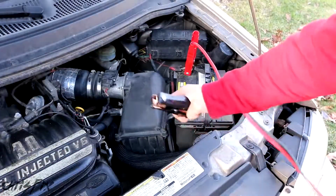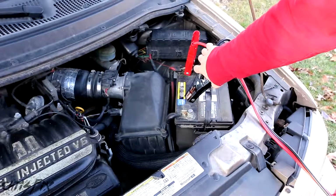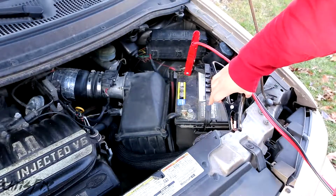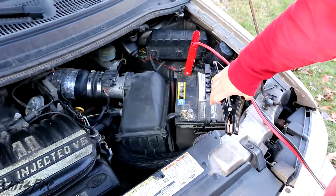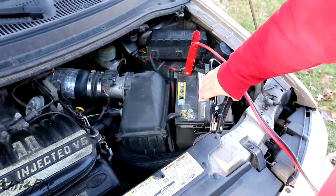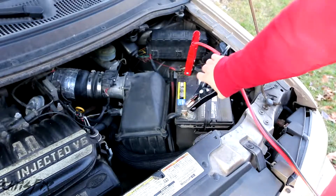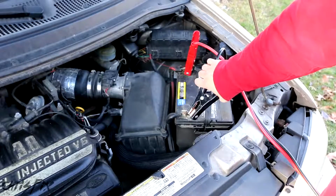Back at the dead battery, this is the last lead we have to attach, but you aren't going to attach it to the negative battery terminal. Touching the lead to the negative battery terminal will cause a spark, and these sparks can ignite any fumes from the battery and cause an explosion. Batteries could create hydrogen gas, especially when they're run down and not working properly, and hydrogen gas is explosive, so to play it safe, just find another grounding point.